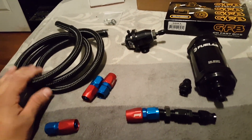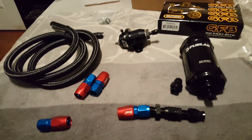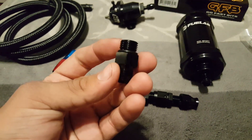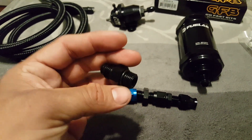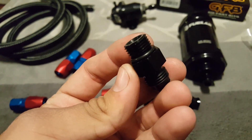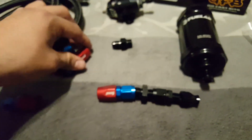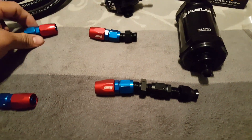even nitromethane if you please. If you're plugging into an AEM fuel rail, you're going to need this fitting here. The threads on the inside of the fuel rail are not NPT — they are straight thread and they require this fitting with the o-ring on it to create a seal. This converts to a male AN where your filter outlet hose would connect.